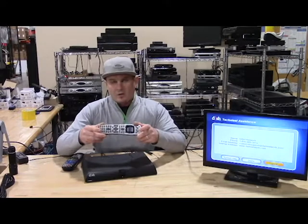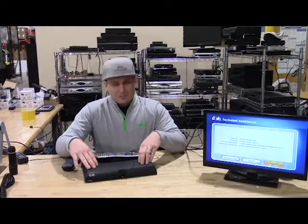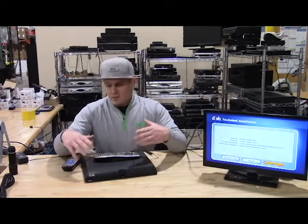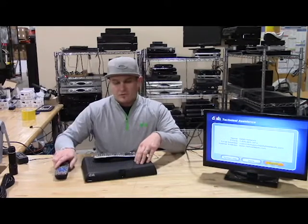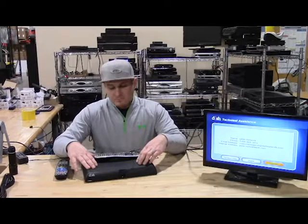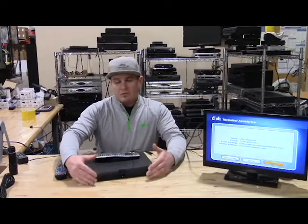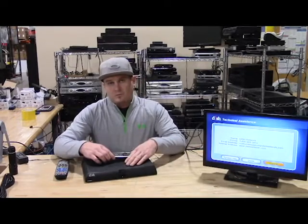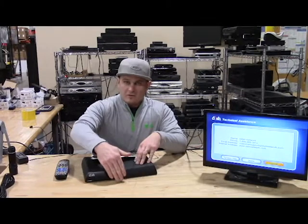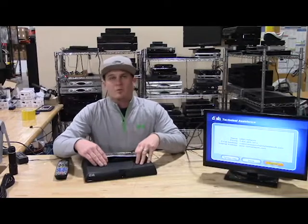So if you have a Harmony remote control and you're experiencing sporadic responses from your device, first you can test it if you have the original remote control for your device by seeing if that'll work through the repeater kit the way you have it set up. Otherwise, try covering your device temporarily with a thick blanket and see if that helps improve performance. If it does, then use some duct tape or black electrical tape to block out the stray signal that you might be getting from the Harmony remote control.